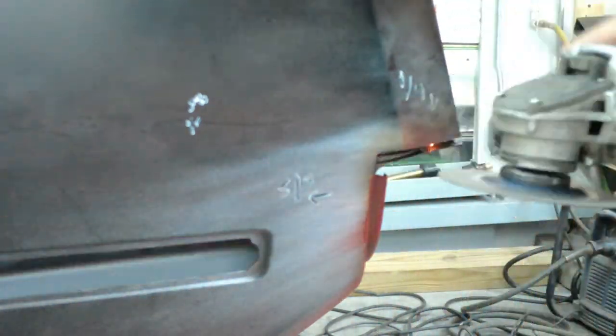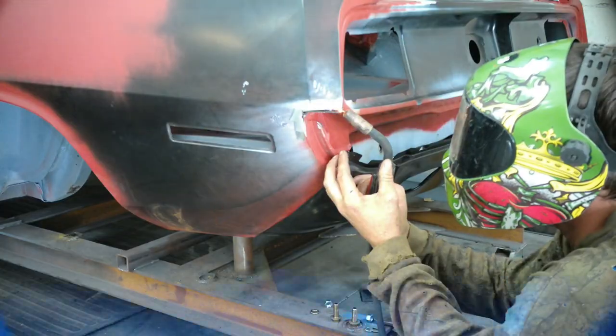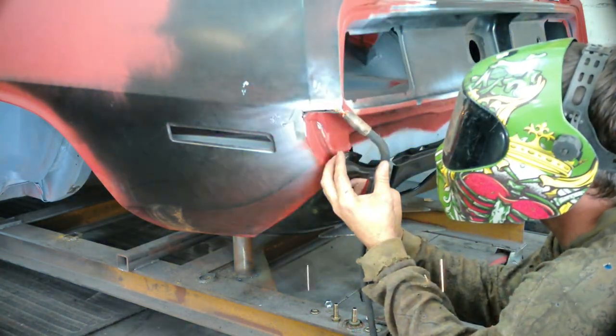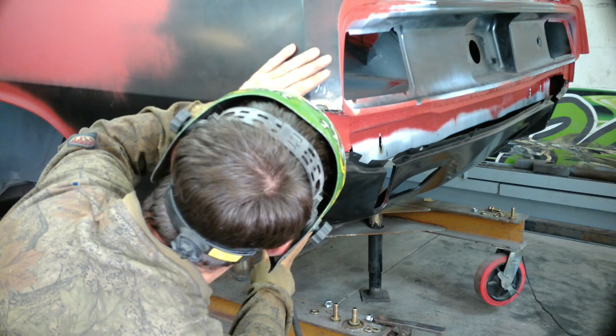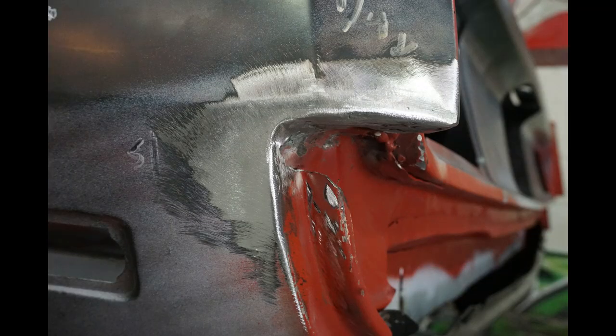With the cutoff wheel we simply cut off the excess where our line was and everything underneath. After that we're going to take a body hammer and just tap it into place — that's going to give our extra clearance. Once we get all our extra clearance we'll take the welder and stitch weld this whole corner back around. Just take your time. It's a little faster since it is on the corner and there's a couple body arches here, so I'm not too worried about warping the metal. After we clean it with the grinder, this is what we're left with — it's going to follow the curve of the bumper a lot more.